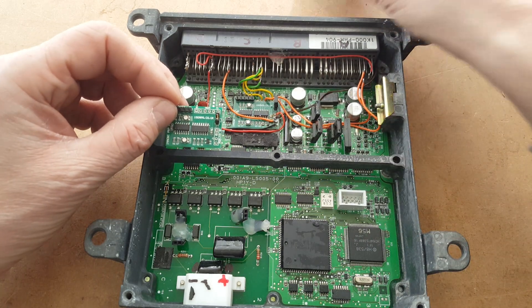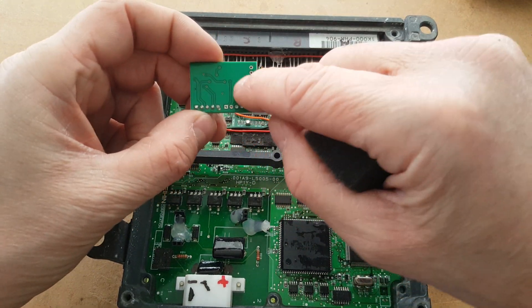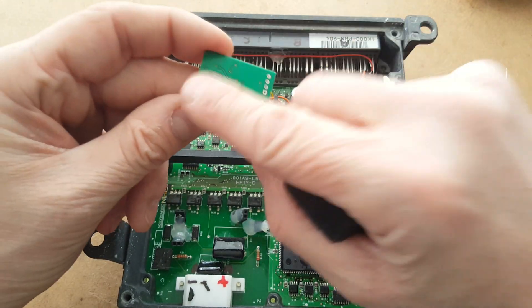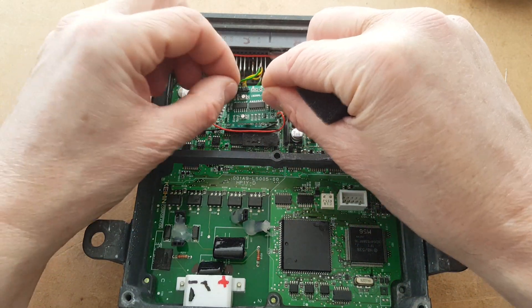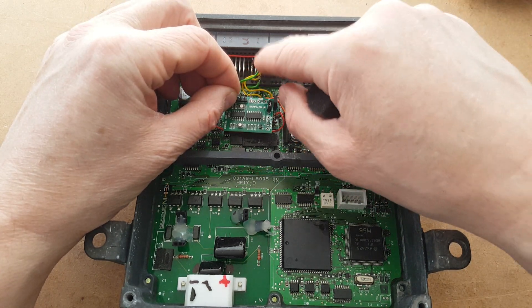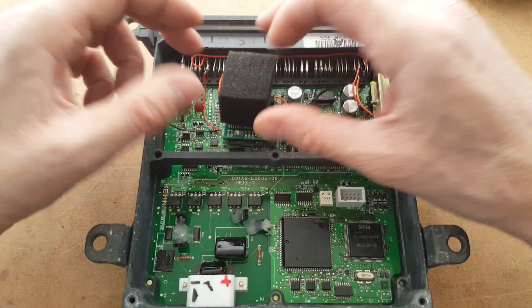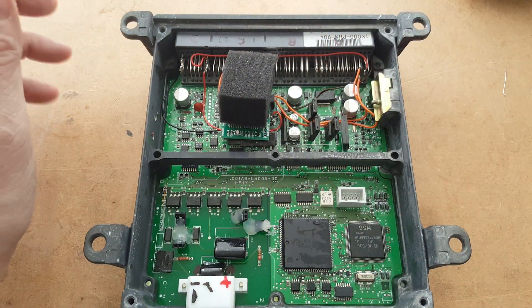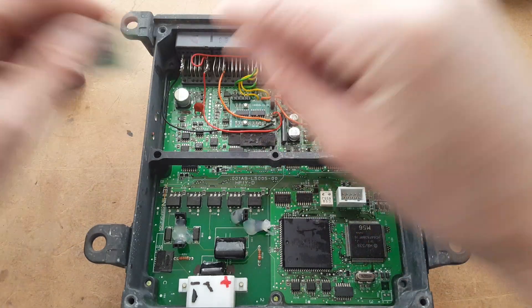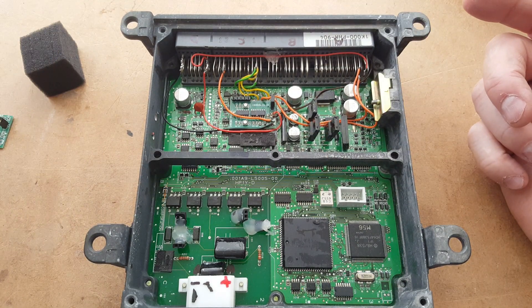Double check your connections and you'll be pretty much ready to go — we just need to do the other wire on the other side. This board is stuck down into the circuit board with a sticky pad, so you need a little sticky pad. Make sure there are no protrusions that would go through it, cover the whole area and stick it down. Best to solder your wires on first before sticking it down. To make sure it doesn't come loose, put a bit of foam on top before you put the cover back on — that will compress it down and hold it, since the board is mounted upside down and will be hanging down in the car.